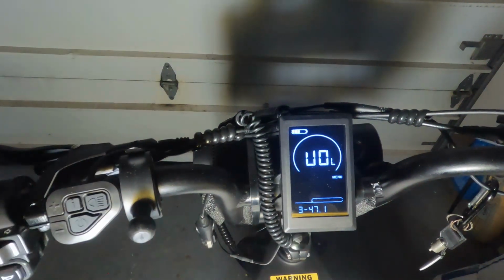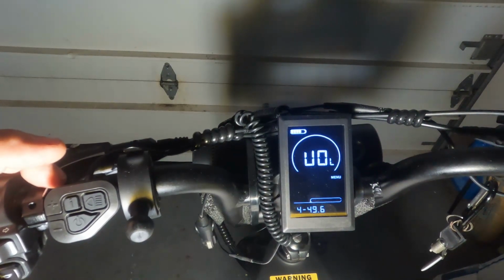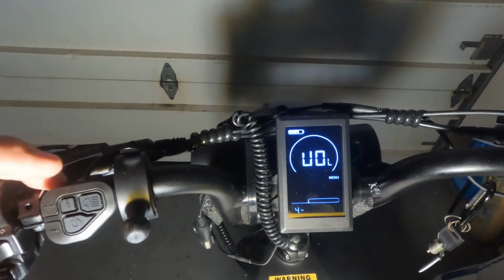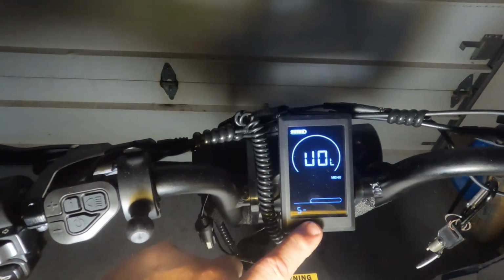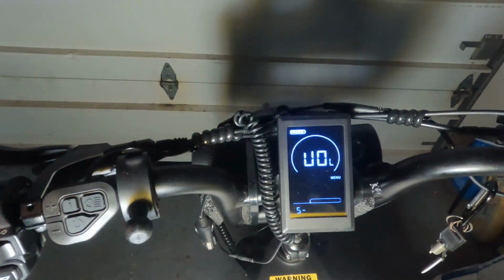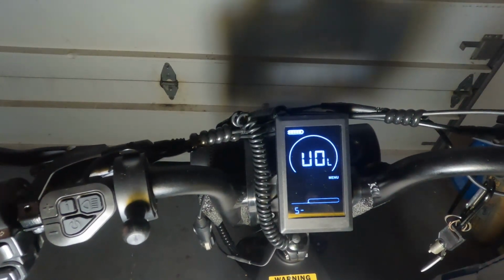If you have a different value, of course, use the plus and the minus keys to change it. Pressing the I key again takes us to the fourth bar where I have 49.6 volts, should be approximately 80% capacity in the battery. And pressing again is the fifth level. At that voltage, it means you've used up 20% capacity out of your battery, so that the first bar would disappear at that point. So now each bar is roughly 20% capacity on your battery.